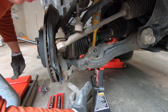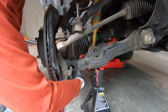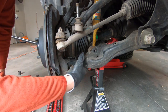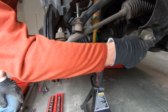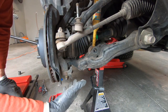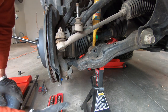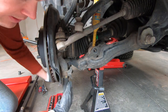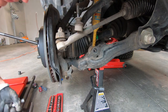Next we're going to remove a 19 millimeter bolt here and one on the opposite side. This is a good step to get a jack stand or another floor jack underneath to support all of this weight. Once we remove these two and then start to loosen up the upper area, this whole thing is going to want to swing down and you don't want to let it swing free — you want to control that weight. Make sure you've got support under there, then get started removing both 19 millimeter bolts.